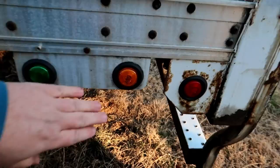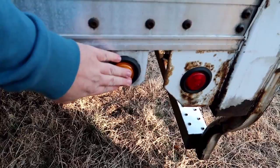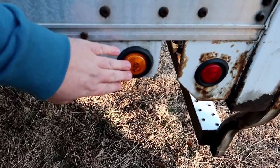And then once you get your first stored code, then you go to the delete code where you want to clear that code. So you do it 4 times. On the 4th time you hold it and the red light will start flashing really fast. And that means it's deleting that code. So then once this is done deleting, you can have the blue wire unhooked. You ain't gonna hold it there once it starts flashing, but it'll stop flashing really fast and then go to the next code.